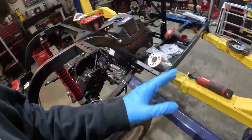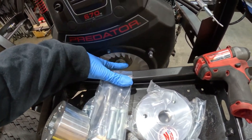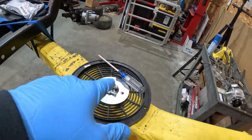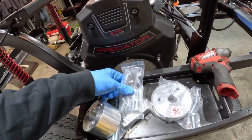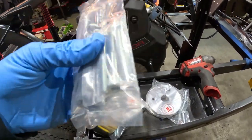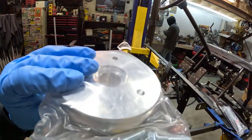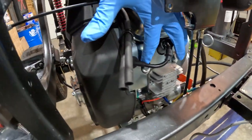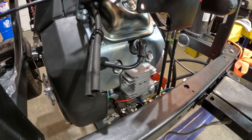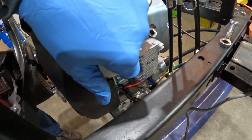If any of you are doing this at home, first thing you want to do is take off the three Phillips screws that hold the grill cover on, then take off the three 10-millimeter bolts on the flywheel side and take the shim out. Next, toss your spacer on there with three Allen head bolts — torque that to 18 pounds. Now get the pulley on there — same thing, half-inch bolts — torque that to 18 pounds. Got the pulley on and torqued. Next, remove these two head bolts with 14-millimeter sockets.